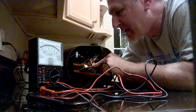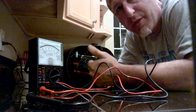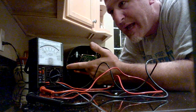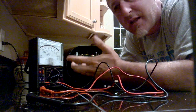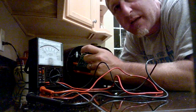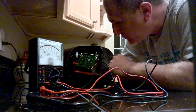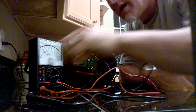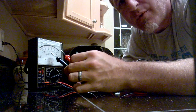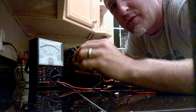What I'm going to show you today is just how to test to see what the problem is. Some of the common problems can be a bad thermostat. You also have fuses — back in the 80s or 90s they decided that every appliance is going to have fuses that can intercept problems like overheating, short circuiting, things like that. So we're going to test all that. What I'm going to do right now is unplug the unit and test for resistance — finding out if the circuit is broken between the two points I'm checking.